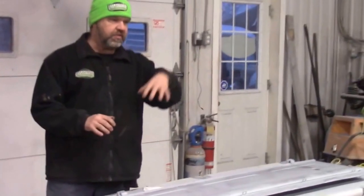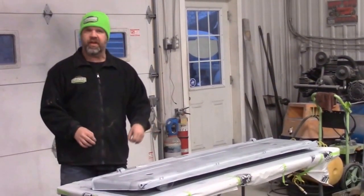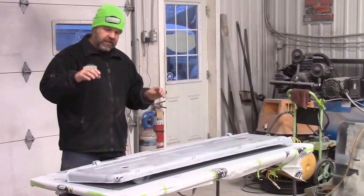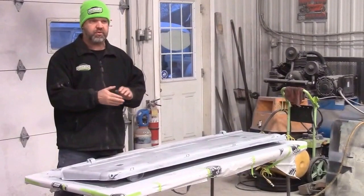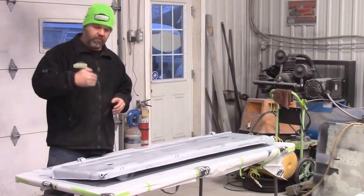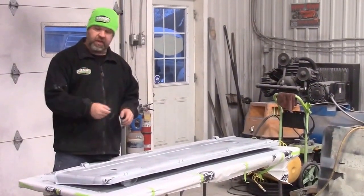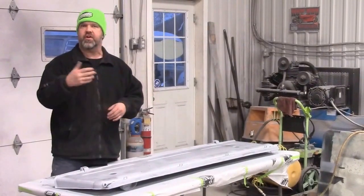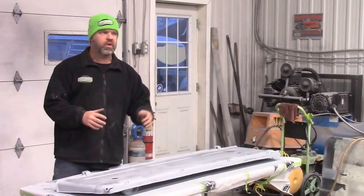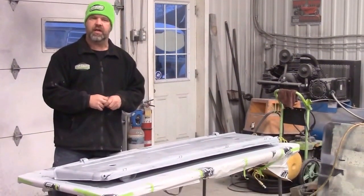Now that we have the tailgate and the folding side panels with the first coat of primer, our next step is going to be block sanding and then smoothing all of the dents and imperfections. It's hard to comprehend the different stages required for proper body work — because if you just show a slideshow of photos, it's very difficult to tell the difference. We're starting with 120 grit sandpaper and going up in increments: 120 first, then applying smoother in different areas, then another coat of primer, then 180 grit, continuing up to 400 grit paper. We'll try to share what the different stages are as we go through, so we all get a better concept of what's involved in the very important body work and block sanding procedure to get it up to the paint step.